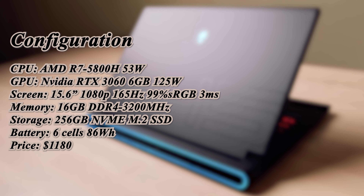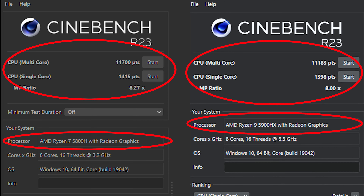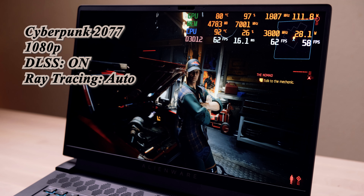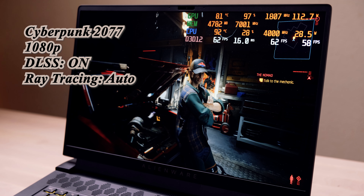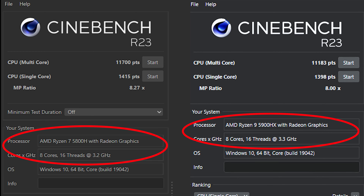The configuration of this laptop is listed here. It is also my most recommended config for the M15 R5. First, don't buy the R9 CPU option. Because of a weak CPU thermal cooling system, the R7 and R9 benchmarks are almost identical on this platform. Based on my gaming test, the CPU very easily reaches about 93 degrees and hits the thermal threshold with the default setting. So a higher operating frequency R9 could only make things even worse.